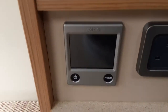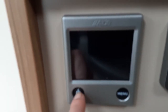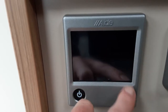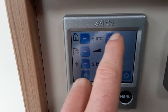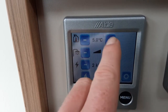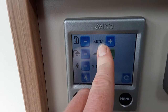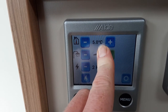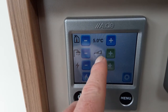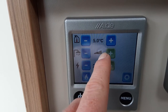That's where the control panel here comes in — it's your heating and hot water control panel. Press the power button, the panel will come on, then press the menu button and you'll be able to control the internal temperature of the caravan plus or minus depending on where you want the temperature to be. This will go all the way up to 30 degrees — a real 30 degrees. Below that you have your water temperature: bar empty means water off, halfway up means water on, and all the way to the top is water boost mode for when you're showering on board.